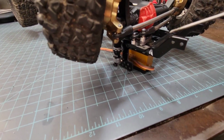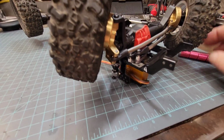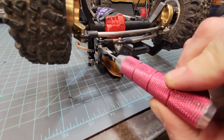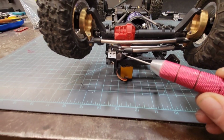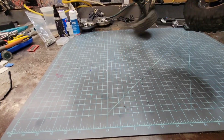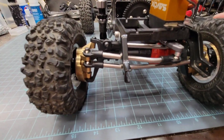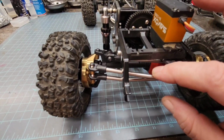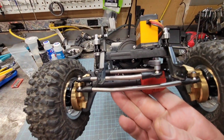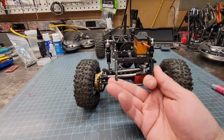So when I had that hole there, that would have hit that rod way before I could have got that sharper steering. I did use a 4mm spacer underneath to space it down, and also a matching 4mm spacer to keep the steering arm parallel. Flip it over. And I also put the matching bend in this. So the matching bend in the steering arm to the panhard keeps them the same length. The spacers keep them parallel, meaning 0 bump steer through the suspension cycle.